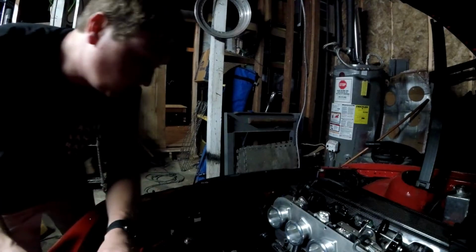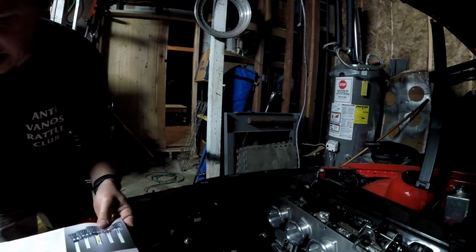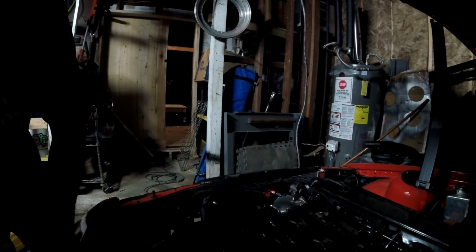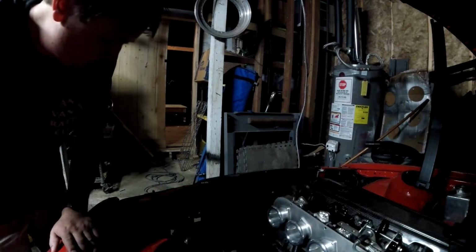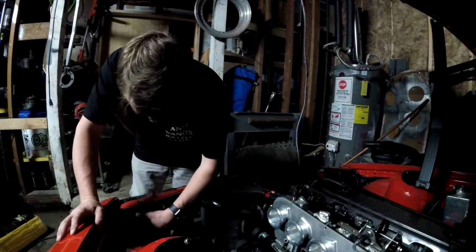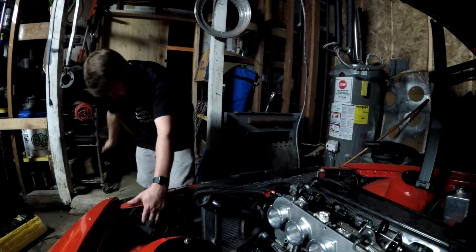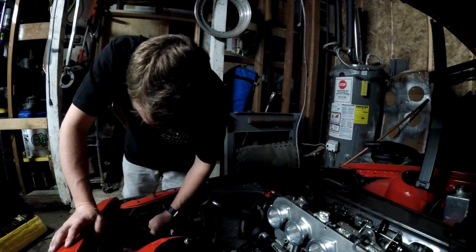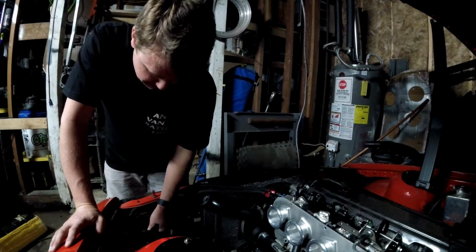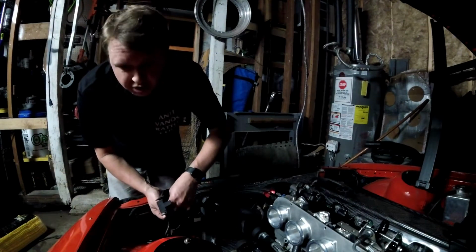Chip replacement, guys, was easy. We just swapped it out, took it inside, did what we have to do, and now we are looking at the headlights. Might as well do these while we have the battery disconnected, since we're working with electrical. So we need to find the H1 headlight bulb, which is right here, the outside one. We'll pull this off. Pull this bulb out. Try not to touch the filament. And we will pull this little rubber gasket out.